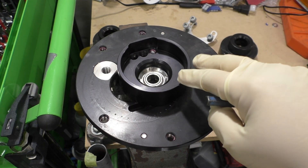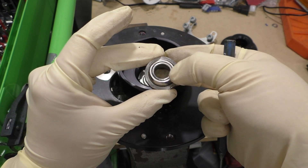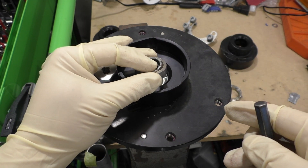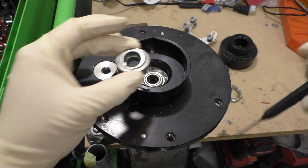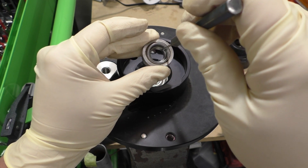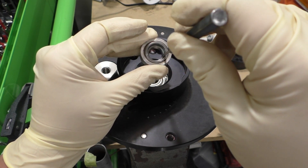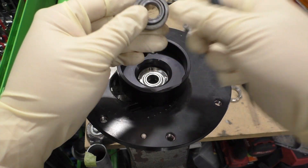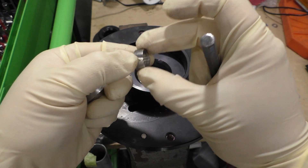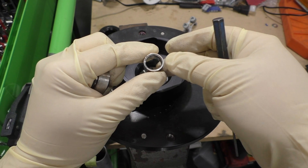What you'll want to do is put your camber plate down, take the monoball, and spin it such that the sleeve is facing down. Then just take a flat punch, put it against the inside lip of that, and tap it out all around. These sleeves have a bit of a serration on them so they can grab the side walls, but they tap out without too much effort.